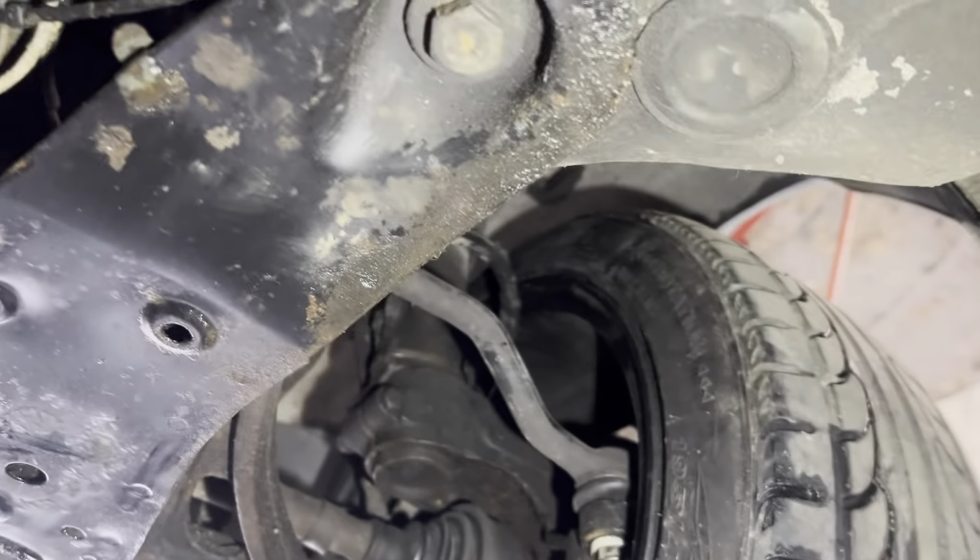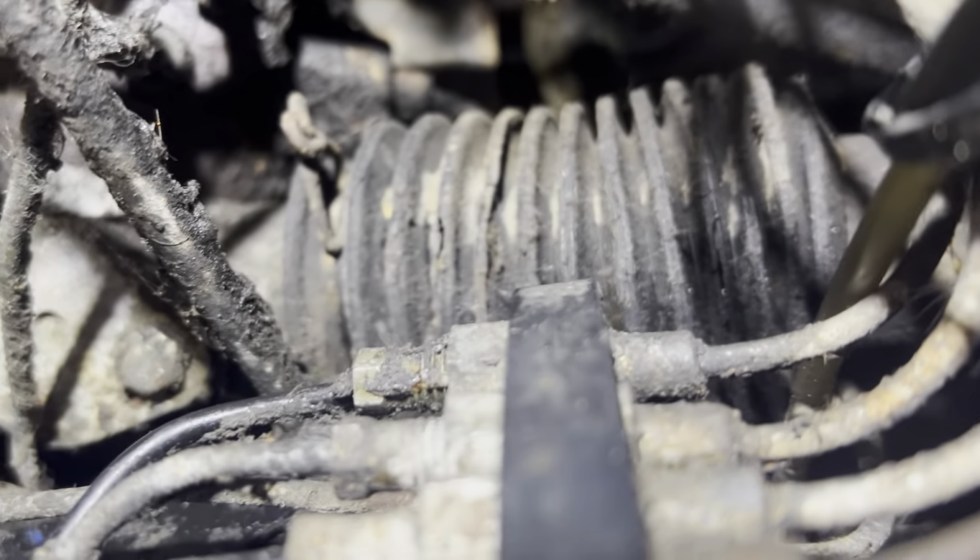On the up and down video, he said something about getting the boots over the track rod end. Because look at where you adjust the buggers, they look like a right shit job to even adjust those. There's not really any good angle to get on those, and the tracking's extremely good on this car. So I'm gonna have to try and see if I can stretch the buggers over, ideally. But they look like original boots to me, because they've still got these old school clips on, super old school clips. So they need to come off somehow. Probably a big pry bar.